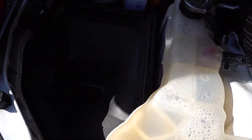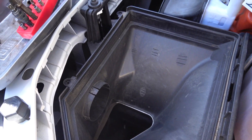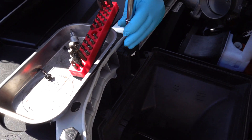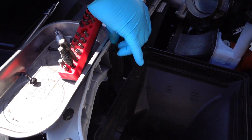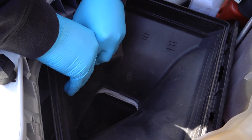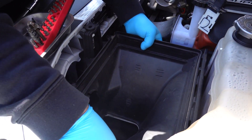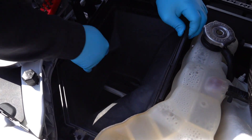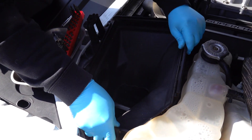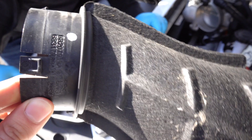See how this filter is just flat? I think it's only this one bolt holding it. I could have taken it all out at once — that's what other people have done in their videos. I've actually watched like four of them. You have to squeeze these tabs to get this out — I think this is the most difficult part. There we go, it's coming out. And that tube comes right out too — that's the headlight vent.